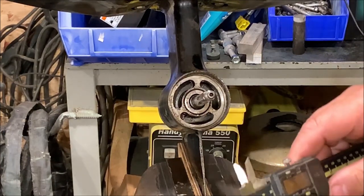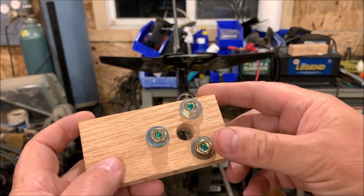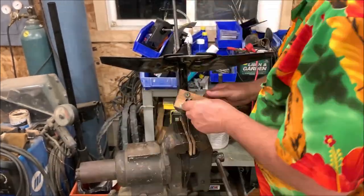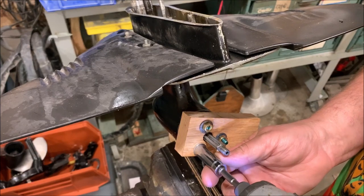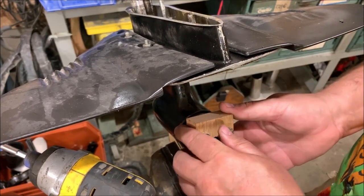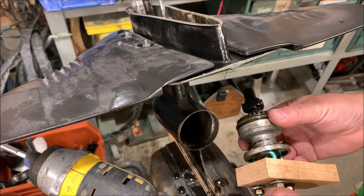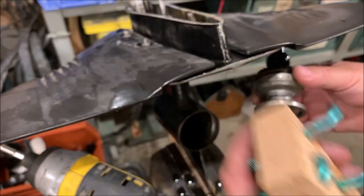This block is probably just right. What you can see is I've created essentially a three-jaw puller — with the nuts I can tighten independently. Let's see if I can get it to fit in here: I want to slide it over the shaft and into the slots. Well, here goes nothing... Look at that — that slid right out, worked like a champ! Now that wasn't crazy tight, but I couldn't get a hold of it with anything else, and that worked really nicely.